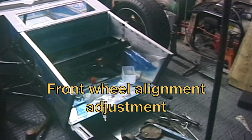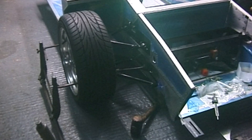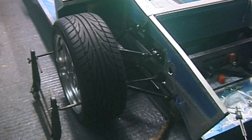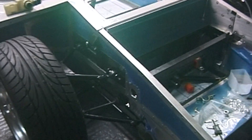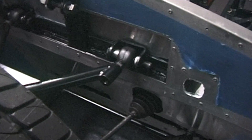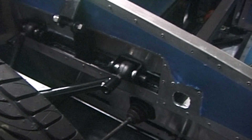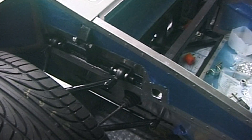I've got the wheels on. I'm checking the alignment — the toe-in seems to be about right. The caster on this one is about four and a half degrees, and it's got about half a degree negative camber. I haven't checked that — it's a bit of a bother though, because the suspension bolts here in fact turned out to be M12 and not half inch, so they didn't fit the rose joints properly, and I've now replaced them. It's a lot better job.